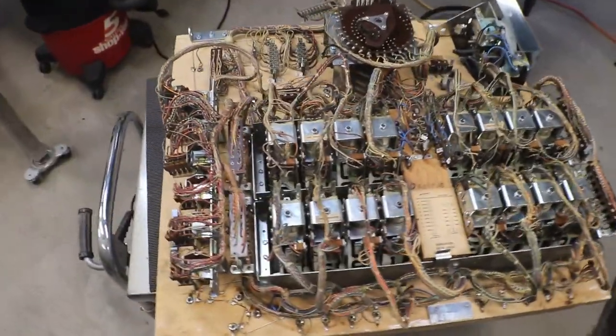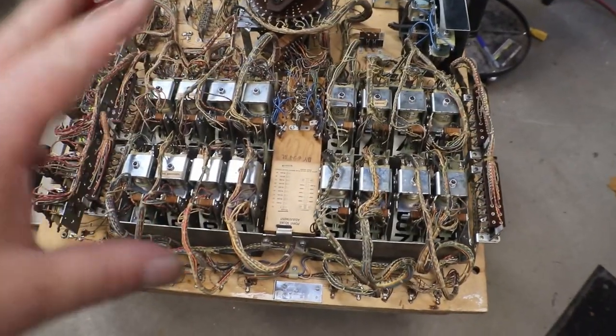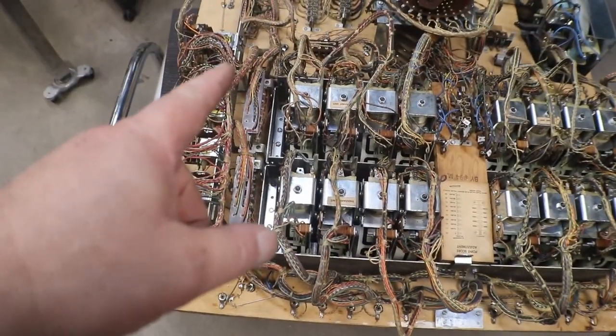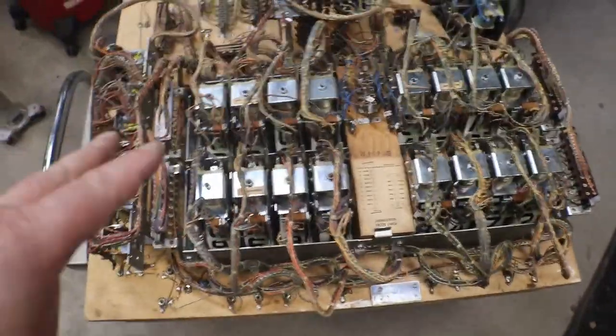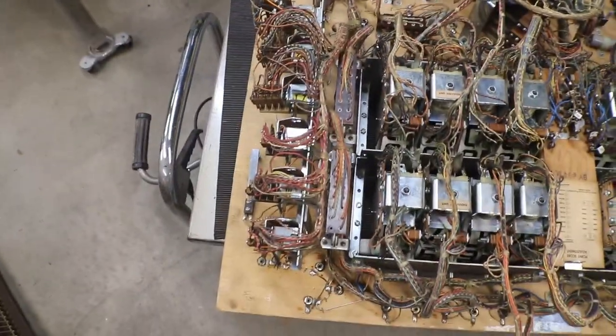Well, folks, it's done. We got everything cleaned up on this back panel. Got all 16 score reels cleaned. All the switches cleaned in each one of them. All the contact plates, contacts, re-sleeved the coils, cleaned the score reels, a little bit of grease here and there in strategic spots to keep it moving like it should. Cleaned up the Jones plugs, which there was just a few of them. Everything's done. All of our relays, stepper, that's the position stepper, the credit unit is done. We are officially done with this and ready to put it back in the box.